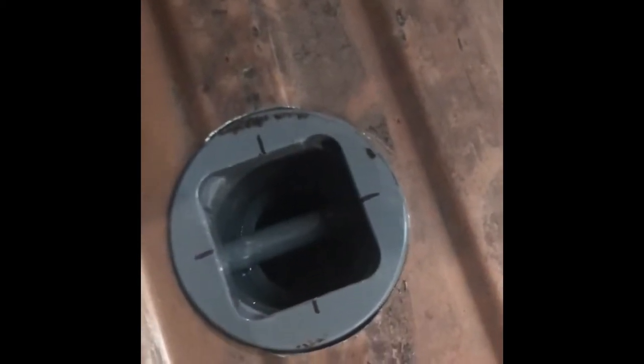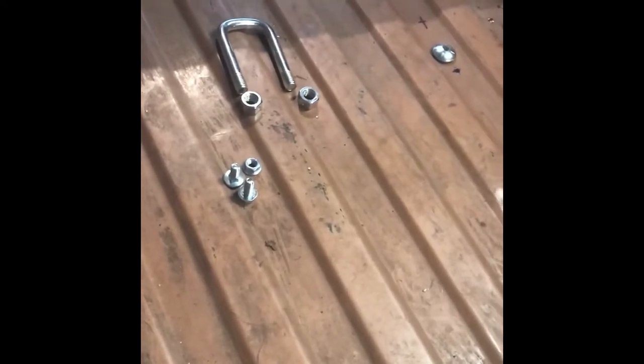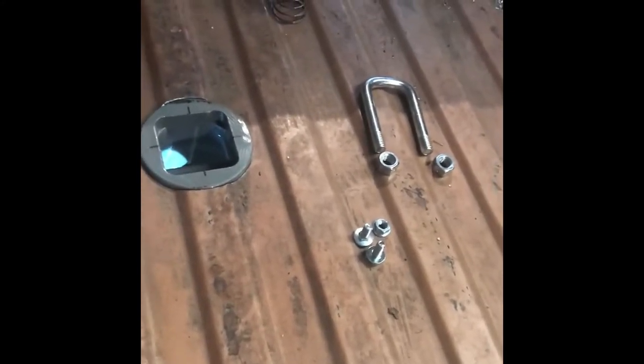They have you torque this down to 90 foot-pounds, so that should be the final major step. Everything is now torqued to spec from underneath — it wasn't that bad. The holes were a little closer to the uprights of the frame rails than I would have liked, so I could only get my torque wrench on one of them and kind of counted threads and eyeballed the rest, but it should be where I need to be.